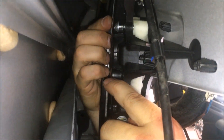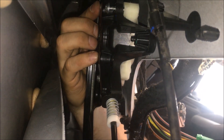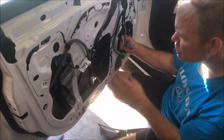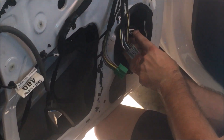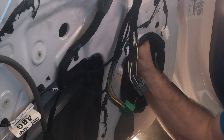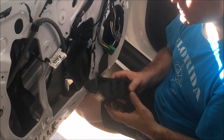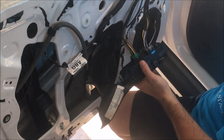Get these top two screws here and here — just hand-screw those in, then tighten them down with your ratchet. Once you've got everything tightened in there, make sure you replace the electrical connector onto the motor — it just slides right in and clips. I suggest that you test the motor and the window to make sure everything works before you put everything back together.